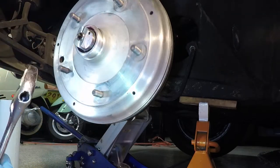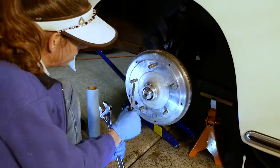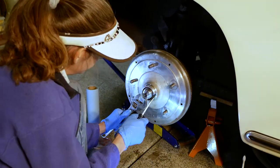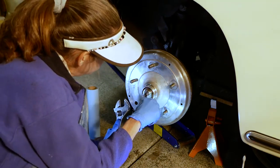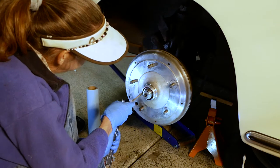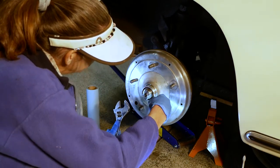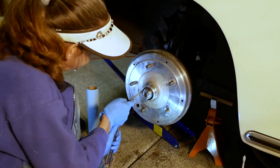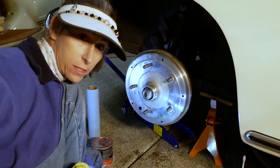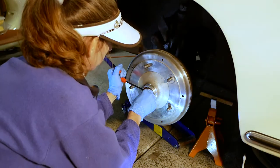freely. So the way I've always set the tension on this, or the pressure on these bearings, is to tighten this bolt enough to where I can just move this washer behind it. You can kind of see it moving now. You never want it so tight that you can't move the washer. That's pretty important. We don't want to forget to set our set screw on the side of this thing.